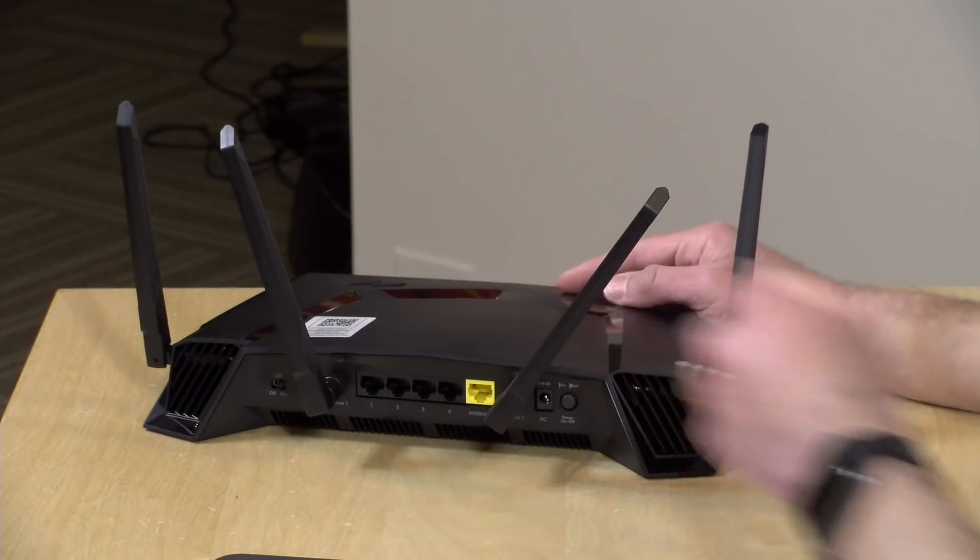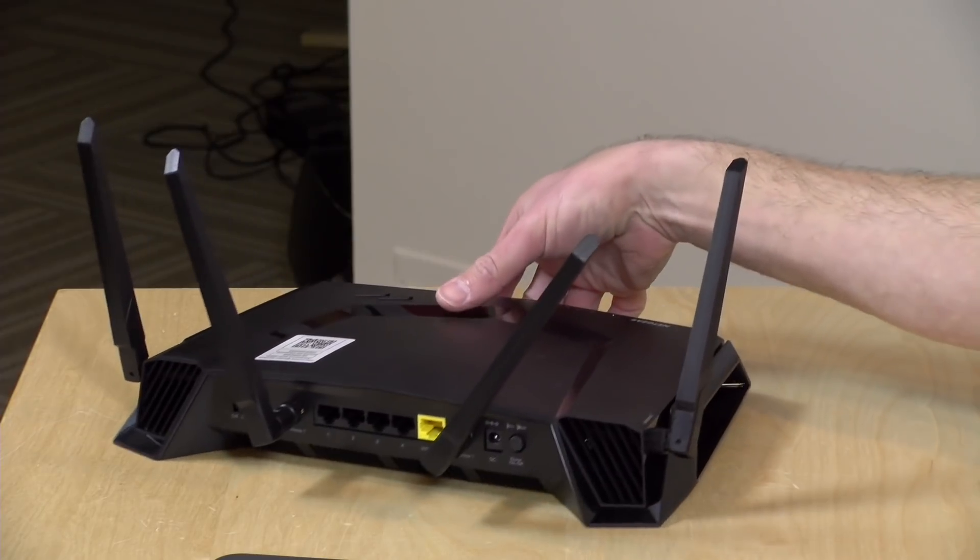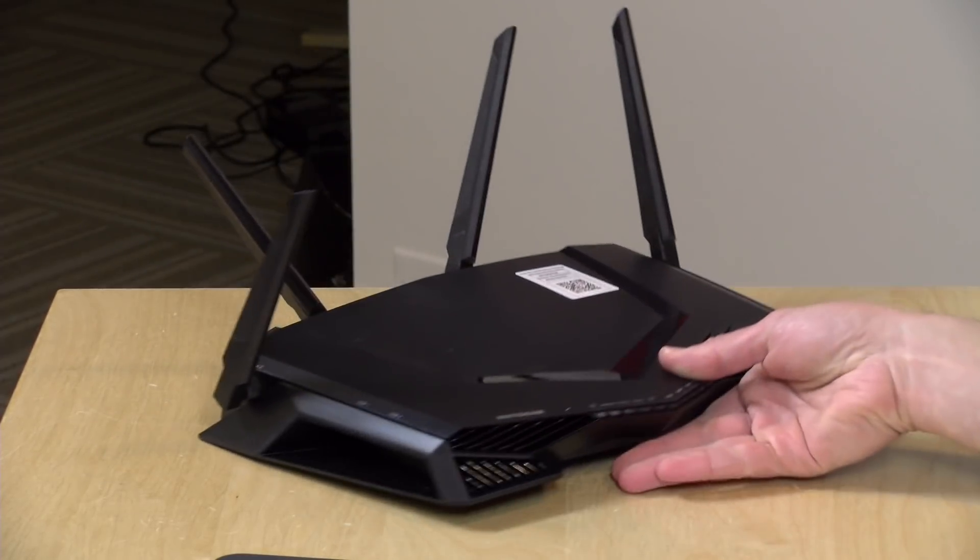I like to remind people that wireless is different in every situation. I live in a very sparsely populated area without a lot of competing Wi-Fi access points, so I generally get good Wi-Fi coverage throughout my home. But in a place like New York City there's a gazillion access points all within the same building that will interfere and reduce your overall range. You also have factors like the construction of your home — a lot of concrete and stucco might absorb those radio frequencies more than my wood frame construction house. What I recommend, especially for gamers, is that you get your computer hardwired into the Ethernet ports because you will get the best possible performance out of that.